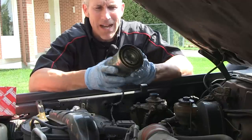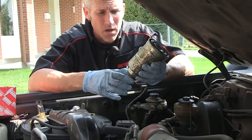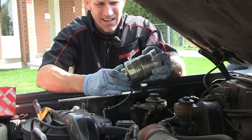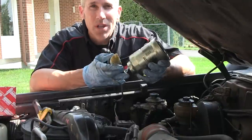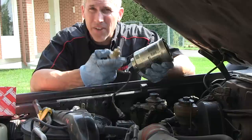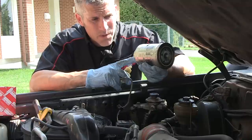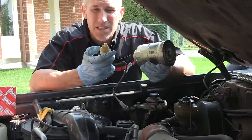This one here — I have no idea when this was put in, maybe 50, 100,000 kilometers ago, so now it's time to change it. I'll remove the sedimenter from the bottom with a little wrench. One other thing you can do to assess the quality of your fuel and your fuel system: drain this into a bowl and look at it — see if you have any water, maybe rust indicating an issue with your fuel tank, maybe algae. In this one I can see quite a bit of sediment and water, so it's just a good time to change it.